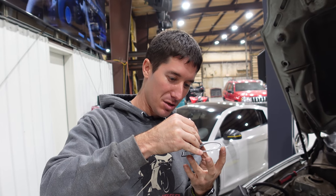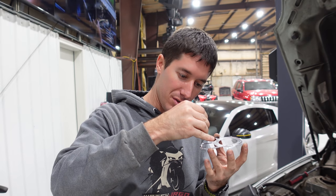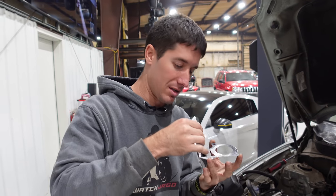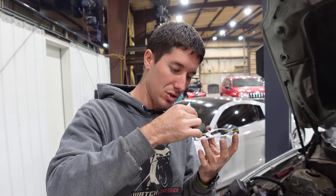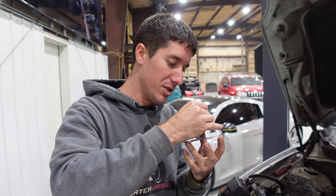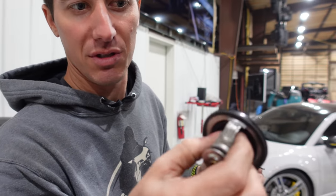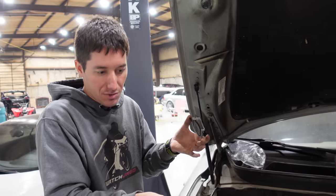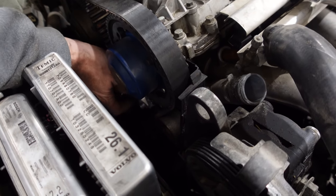The last piece of this thermostat puzzle — we pretty much have this wrapped up except for the new hoses. Putting all the new RTV on here, we can put the cover on the thermostat housing and put the thermostat itself in. That knocks out the majority of this cooling system rebuild. The hoses shouldn't take too long. The heater core hoses though — I'm going to have to lift this thing up and that's going to be a whole other day of work. The thermostat on this is keyed; I'm going to put the vent up, the little bypass, and you'll see how it has to go this direction straight up and down. This is also a lot harder once this little nipple is installed.